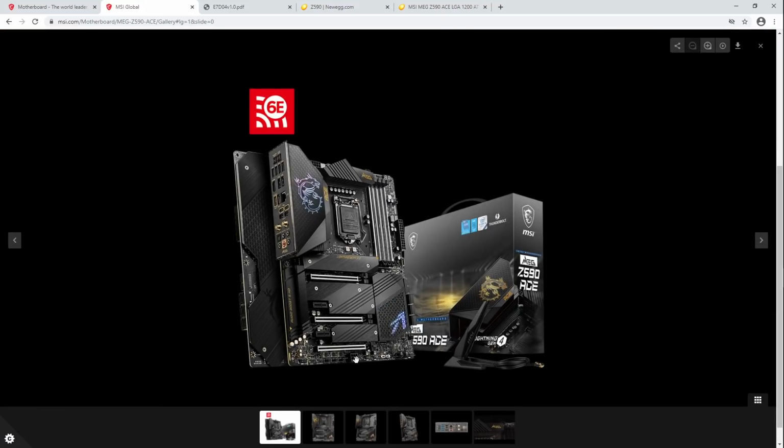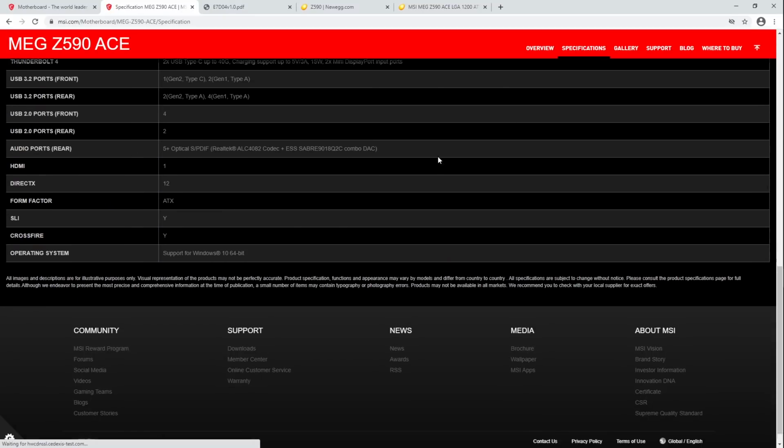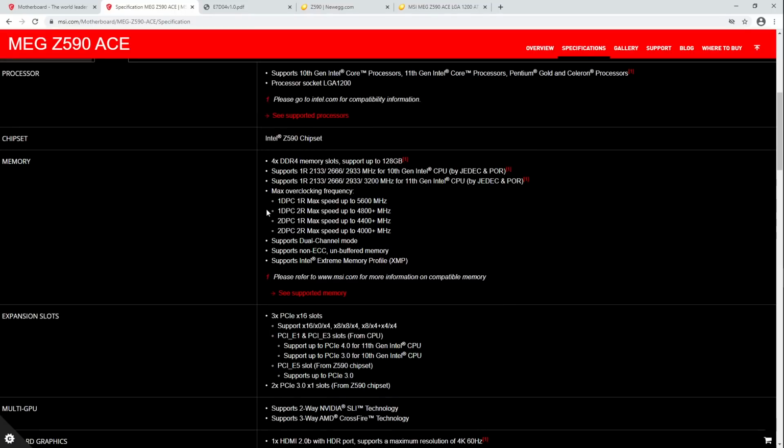Also, speaking of connectors, notice that 6-pin down there and how it's pointing straight up? Good luck plugging a GPU in above it. Also, I don't think that PCIe slot spacing is capable of SLI. Actually, did they even bother licensing SLI? That's always a fun fact. Motherboard vendors have to license SLI from NVIDIA. So having SLI support adds cost in the sense that you don't actually have to physically do anything to the board to support SLI. You just have to go to NVIDIA and ask, hey, can we enable SLI support on our motherboard? And they're like, yeah, just give us money.